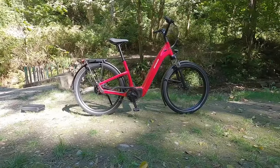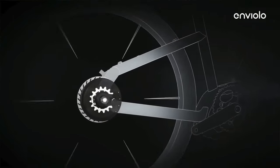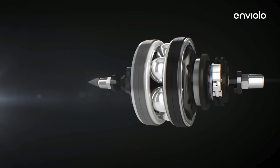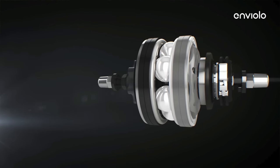And it's the IGH — internally geared hub. In this case, it's actually a continuously variable transmission from Enviolo. So you shift and there's this ramp, and these orbs inside, giving you a really smooth variable range between low cadence and high cadence.